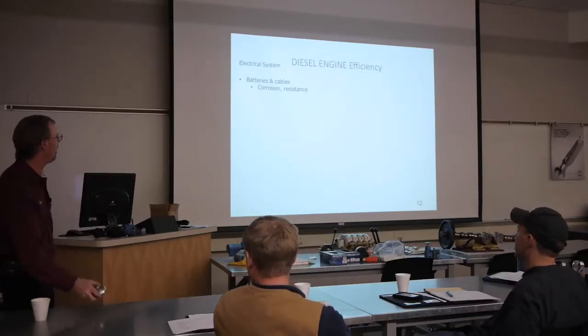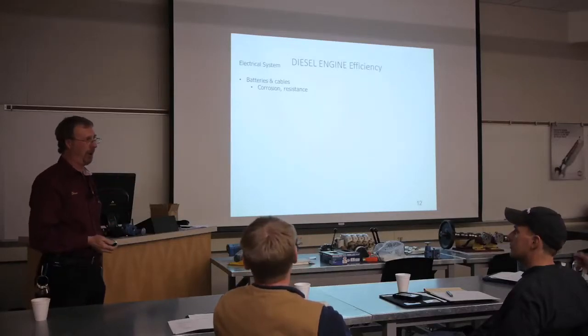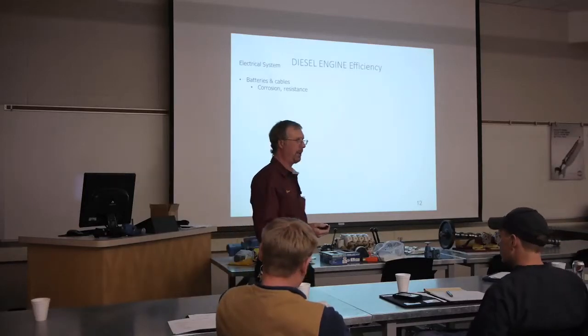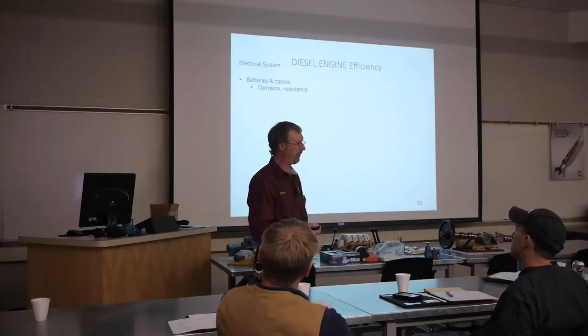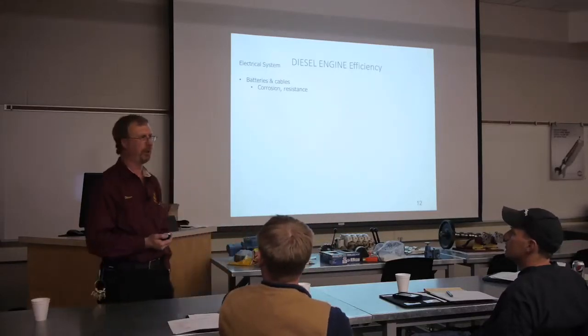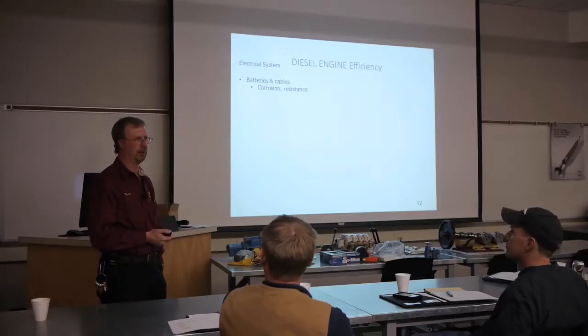Okay, so back to our resistance. We need to take care of that corrosion. A fully charged battery is typically rated at 12.6 volts. 12.4 volts is 75% charged. 12.2 volts is 50% charged. And 12 volts is a plumb dead battery. Most people think, I've got 12.2, I'm good to go. Well, actually, no, you don't.